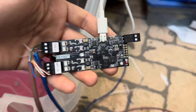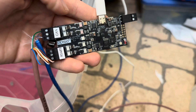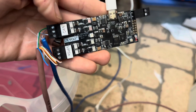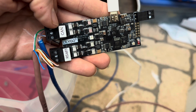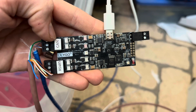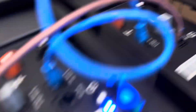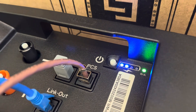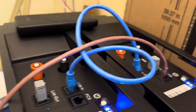So what I've done — I've got a LilyGo here, and this is essentially an Arduino device. You can write C++ code onto this thing and it's got a CAN bus port, so I can broadcast and receive messages on this Arduino and even do some manipulation of messages in and out. So I can send the Keep Alive across here to the battery.